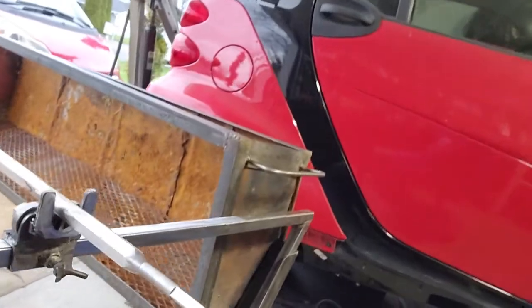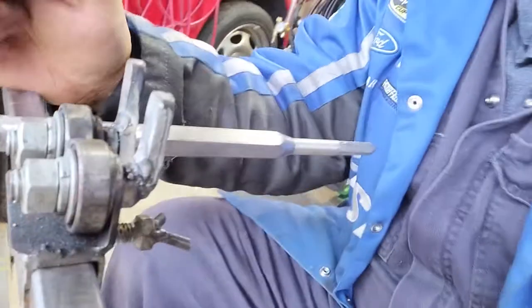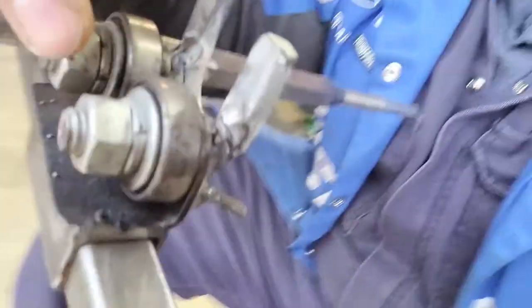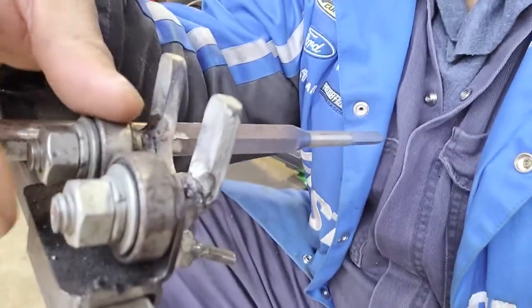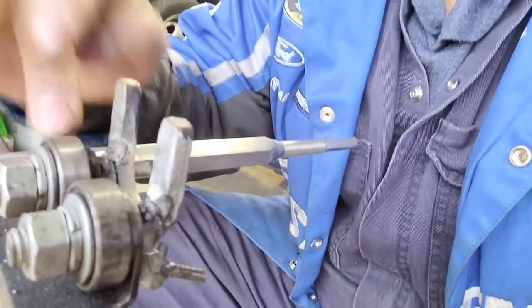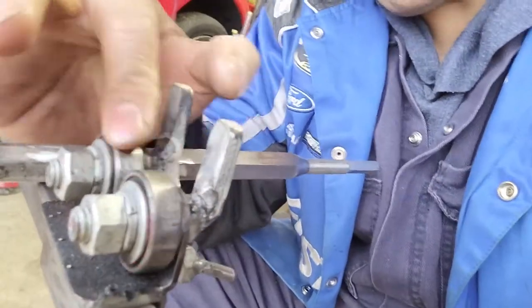You want to see it closer — what I welded? It's right there. So you can see the way I designed it. If the bearing is bad, you can easily unscrew it using a 16. And then you can replace this one. They're only like $2 at auto parts — they call it the pilot bearing on a Toyota 22R.